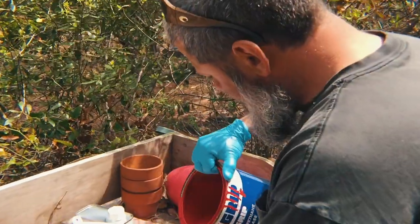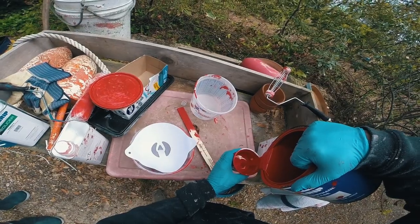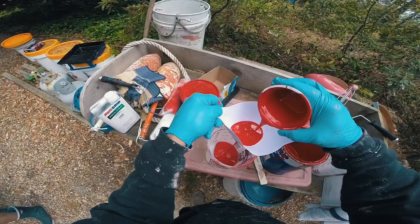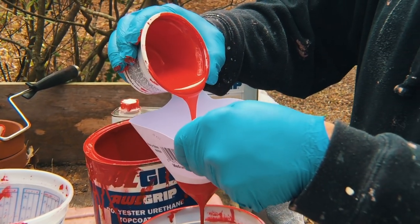It's time to start painting, get your mix master out. We used Awlgrip. It's a two-part polyurethane. Interesting side note, I had a bunch of leftover paint. Specs say it's good for 3 years. My paint was 12 years old, some was 7 years old. It didn't matter, I mixed it all together.